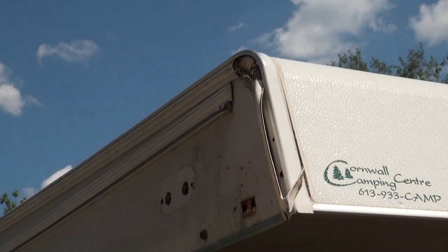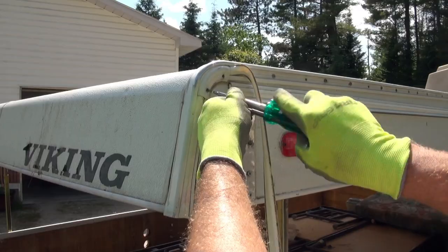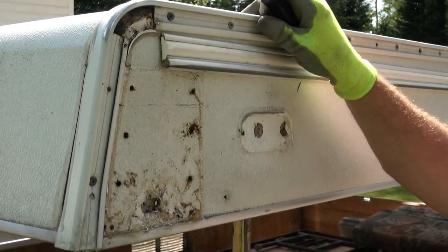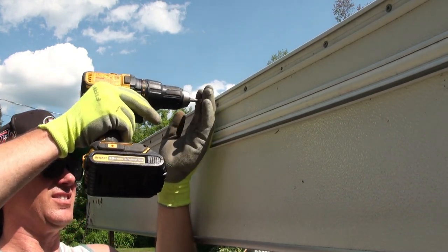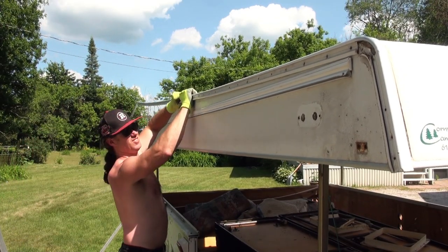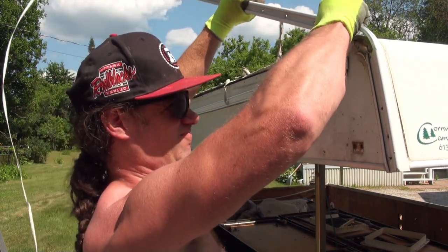You see, I'm trying to get things apart here. And as I was taking things apart, I realized how the roof was constructed. It is basically a vacuum seal process in the factory with sort of like 1-inch foam, 1/8 Luan plywood, and then the skin of the trailer. And it's glued down with some kind of RTV stuff, which does not come apart. And if you were to get that apart, you just screw the metal up pretty badly in the process anyway.